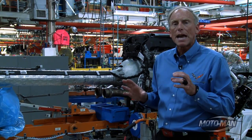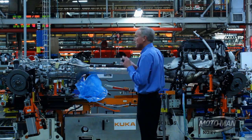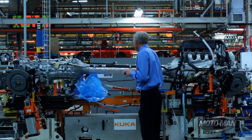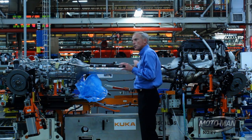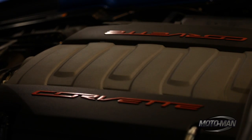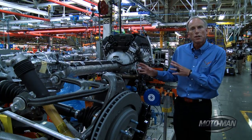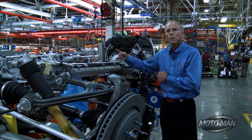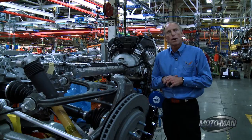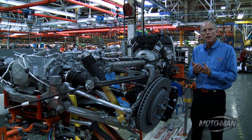For the C7, we actually had to triple — that means 300 percent — the stiffness of the previous generation car. So we actually went from aluminum to steel. The reason we did that is to reduce noise and vibration when the engine is running in four cylinders. In four-cylinder mode, the engine doesn't produce perfectly smooth torque throughout the driveline, and because of that it sets up a vibration inside the vehicle.